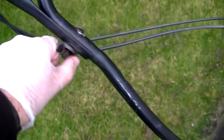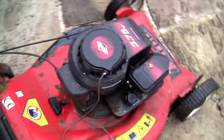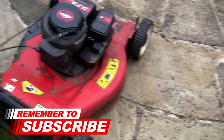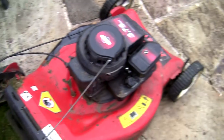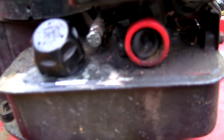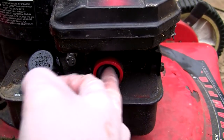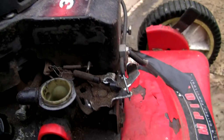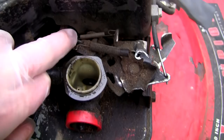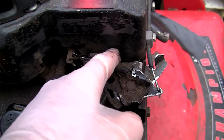I've just dropped a bit of petrol in there. Everything's really old and really messed up here. One thing I've noticed is this pull cord — it's out so far it feels like it might pull over. The air filter box is on the wrong way; there's some sort of different bolt through there, so someone's had a play about. I've got a set of governor springs — on eBay these are about four or five pounds each, so there's a tenner there potentially. That spring's been bent forward a little bit — someone's tried to speed it up.